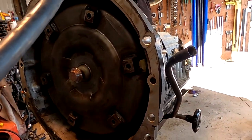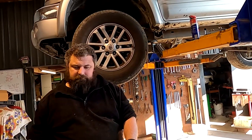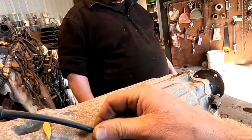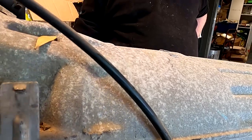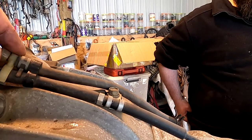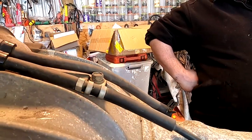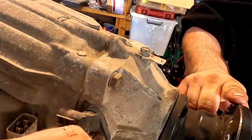I probably should wire the four-wheel drive engagement. What'd the oil look like? It's alright. Wasn't disgusting and yucky. No, it's deep colour. And the line pressure cable's still in good order. It isn't all cracked to bits, which is nice. I wonder if he wants the long breathers on it, going four-wheel drive. Nah. We might run the big long hose for him, because it's hard to do when it's in place. Awesome.